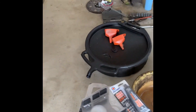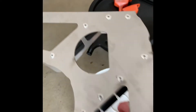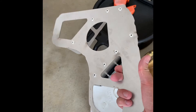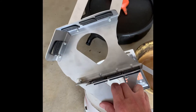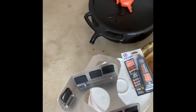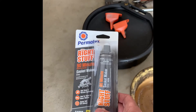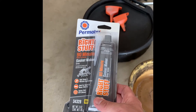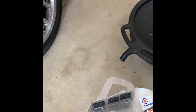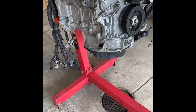For this clip I'm going to start the process of installing the oil pan baffle that I got from Wilhelm. It's a pretty nice piece — everything's cut out nicely and it just lays directly in the oil pan, then you put some RTV around the edges to hold it in place. It has some nice flat valves and whatnot. I'm going to be using Permatex Right Stuff for imports — this stuff seems to work great, I've never had a problem with it in the past, so I've always been a big fan.